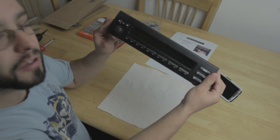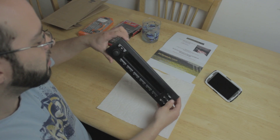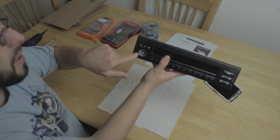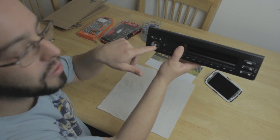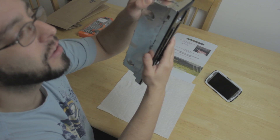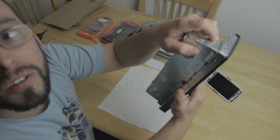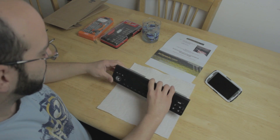I took the radio off. Very easy — you take the button off, put a T10 screwdriver in here, and you turn, you do like a quarter of a turn, don't force it too much. It's just that when you turn that, this thing moves in. It's a little turn, just pressures this thing to the inside.